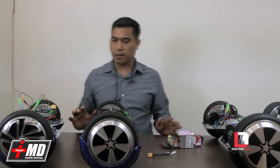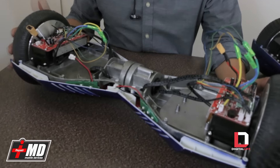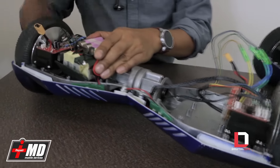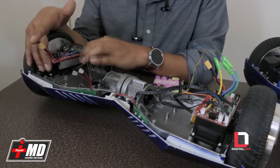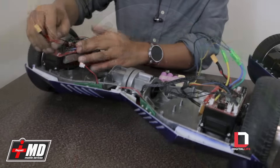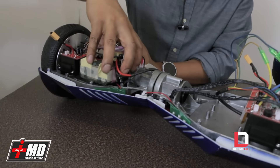What I want to give you guys is the rundown of what to look for in a board. We're going to start with the lowest end. If you have an opportunity to open it up and you don't see a main logic board — all you see is a battery next to the logic board like this — this main one here has a logic board integrated with a balance sensor. Everything is crammed into one, and the motor itself is really close to the source. This is a heat sink, and the heat sink is resting against the battery, which is a bad sign.